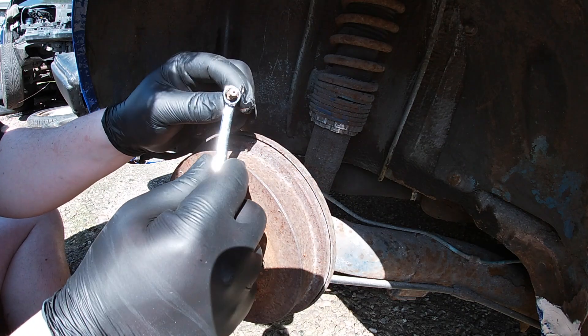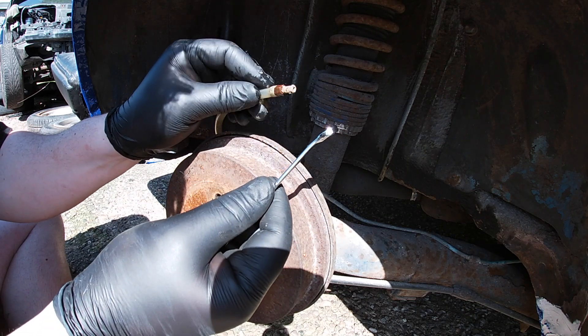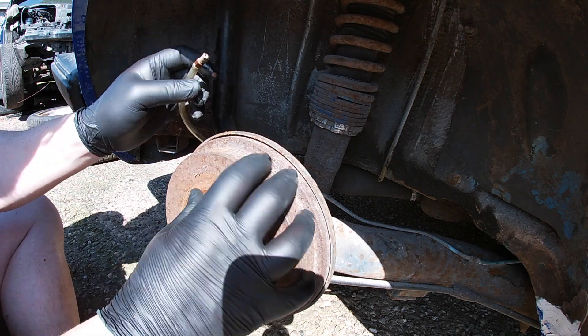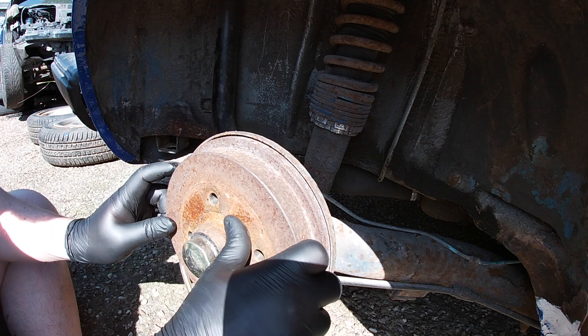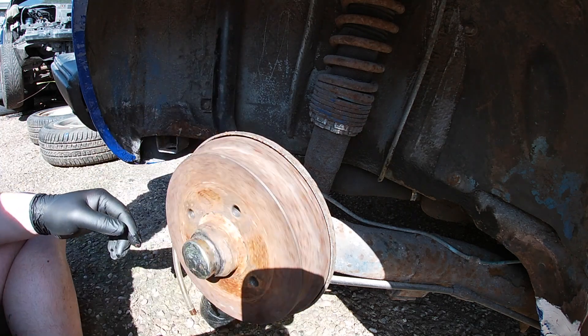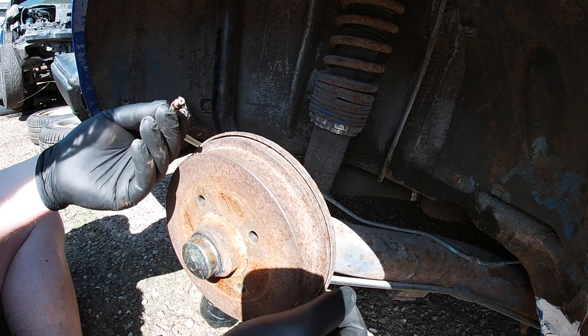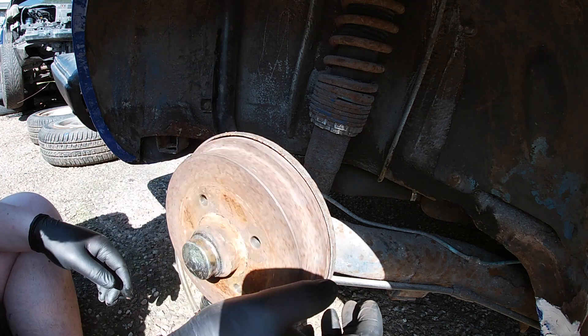What's just happened is when we went to bleed the brakes the nipple has broken. If Anthony puts his foot on the floor it does move a little, but the cylinder is probably seized as well as the nipple. That's something to change in the future - I don't have the part right now but it will be changed soon.